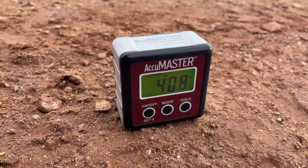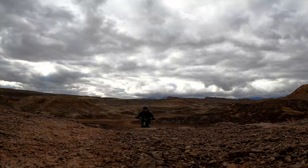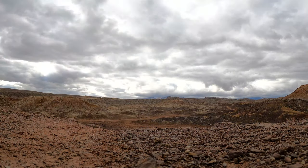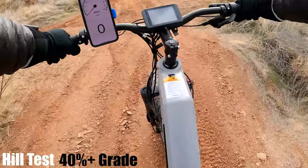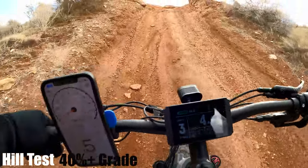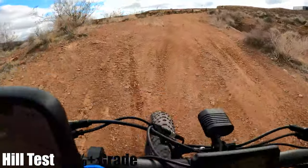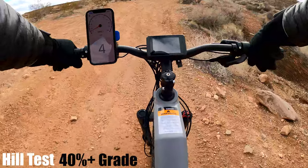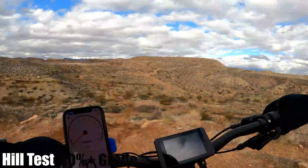There's no official hill rating for the HD, but the motor produces 80 newton meters of torque, 160 peak. I measured the hill in front of me at 40% at its steepest. In the lowest gear with power on, I felt resistance but it made it up. Then I found a hill of the same steepness but about three times as long — and it made it up that too, though I had to stand and it was a serious workout. That's the steepest hill I've ever climbed on any bike.